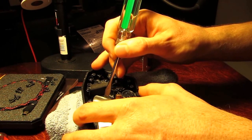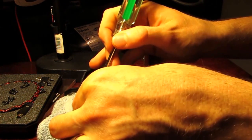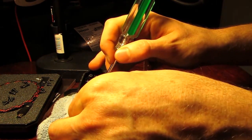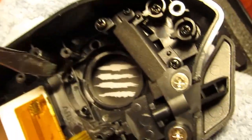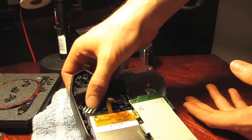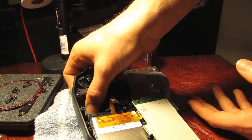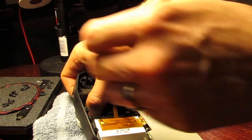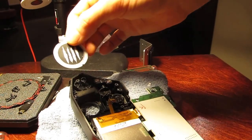This is the diffuser. We don't want to damage this. Alright, there we go. Came off slowly. No residue on the plastic. That might be reusable. And you can see way down in there is the reverse side of the image that we want to get rid of. And no need to take the little plastic pieces out. You can actually just apply pressure by putting your thumb right on the logo and pressing slowly and slowly, and it'll peel right out. And you end up with the logo separate.